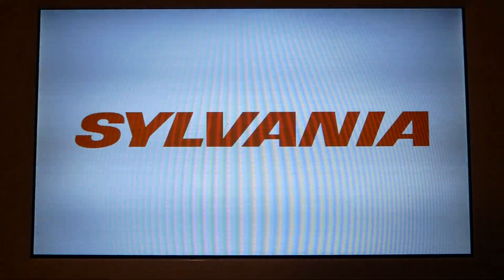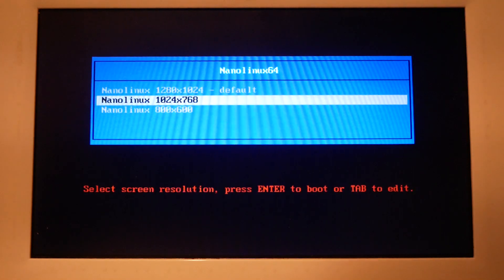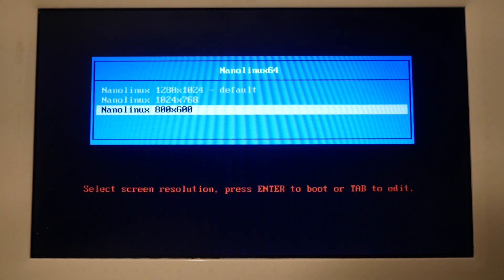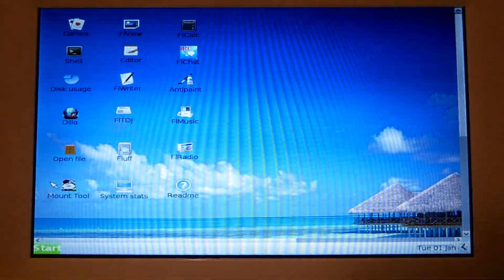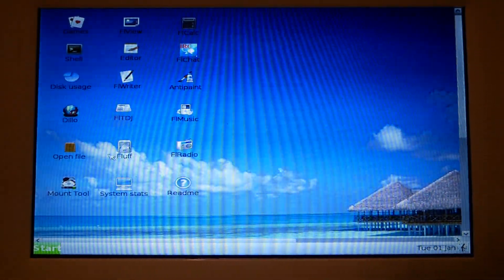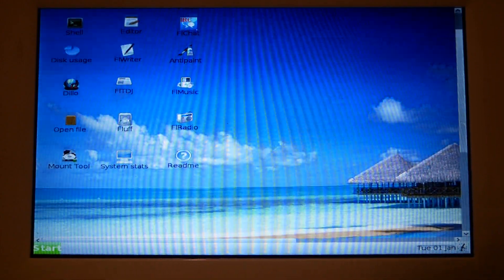There are certain video modes that don't work — like 32-bit. I tried to use 800x600 but that didn't work initially because the colors were a little distorted. If you press Enter at the boot screen, you can select more options. This is a 1024x600 display, so it's really the only way to get it to run properly, especially with older 800 or 640x480 setups.